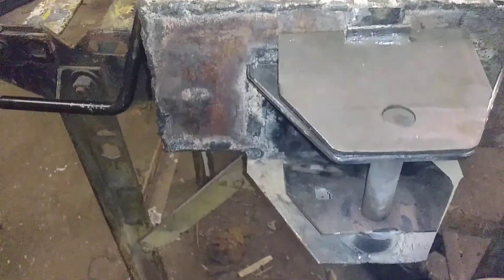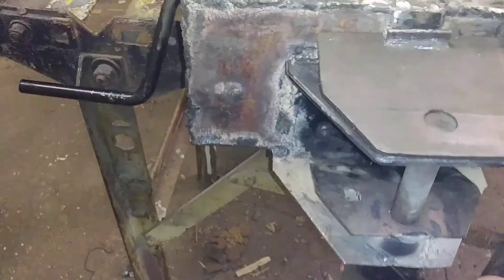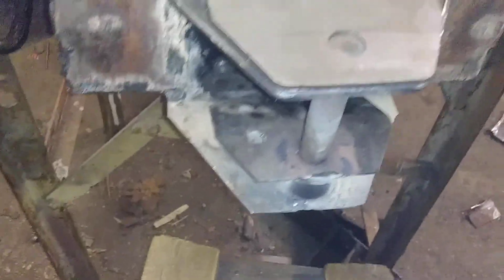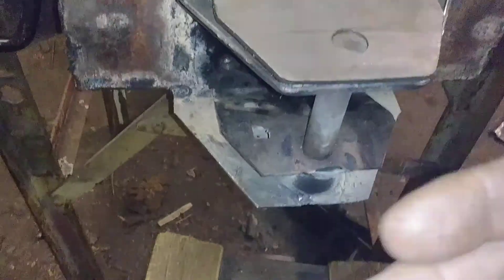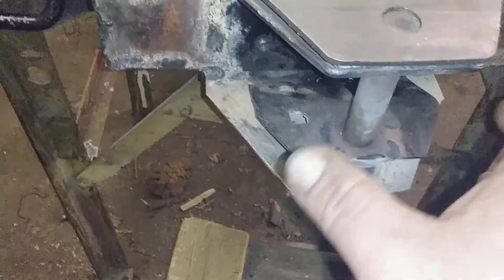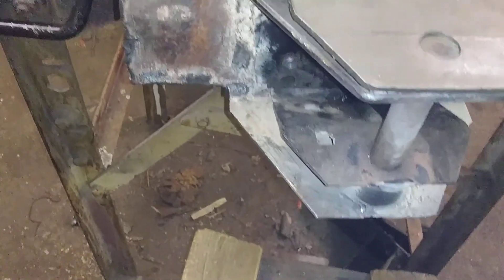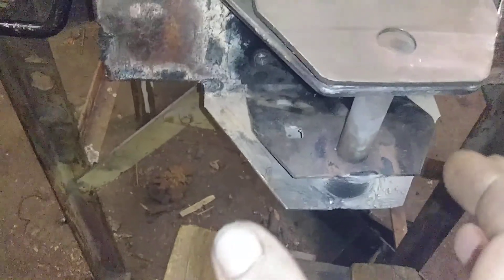The pin goes up and down through there nicely. I'm gonna be making my clevis, similar to a caterpillar or whatever - it goes over this side and over this here. I'll be making a plate here that I can weld to the front of Bronco, on the back side of the front half, so it'll pivot. A strong pivot point in here - it'll be good to go.